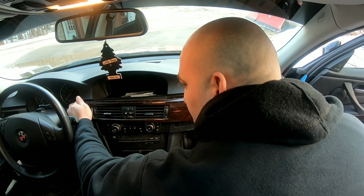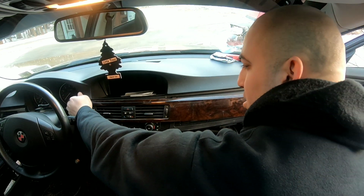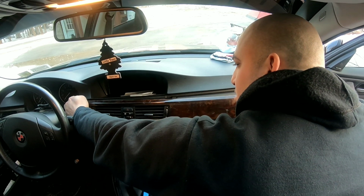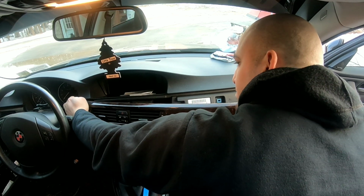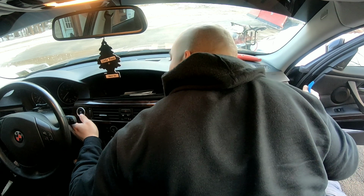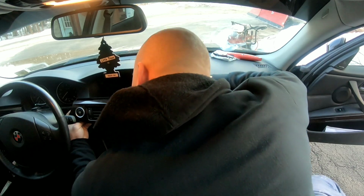Now we have to be careful over here. Well, next to the push start button, be careful because you're gonna have wires over there. So keep taking it out. Easy. You don't want to break anything. There we go. So it's already removed all the way, but you want to be careful because I'm gonna show you right now. See, you got some wires over there for this button, so you don't want to pull it all the way.